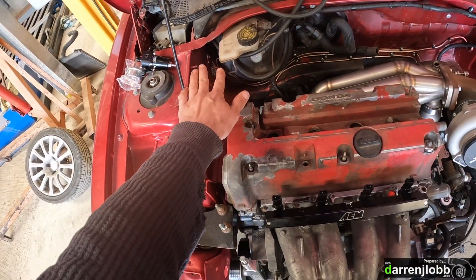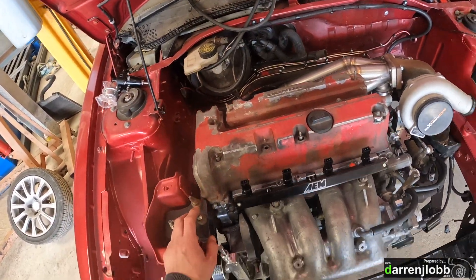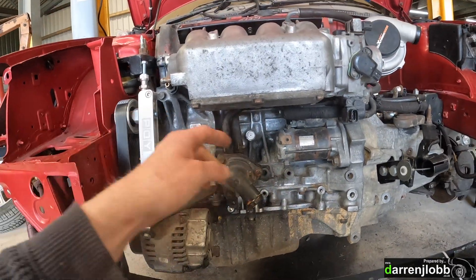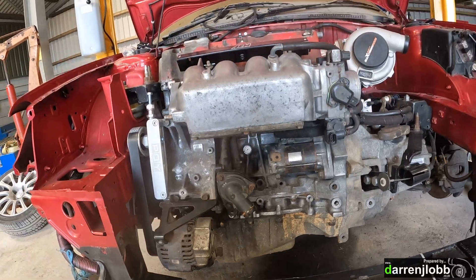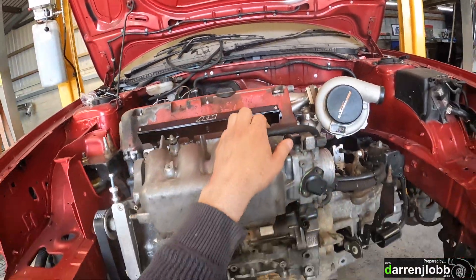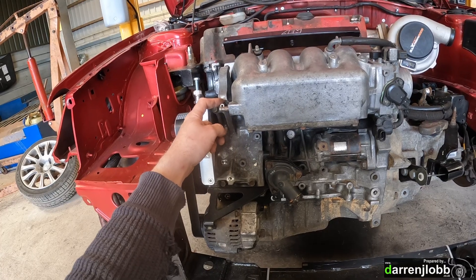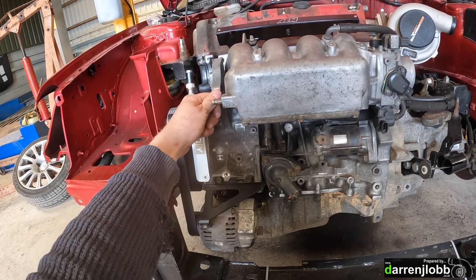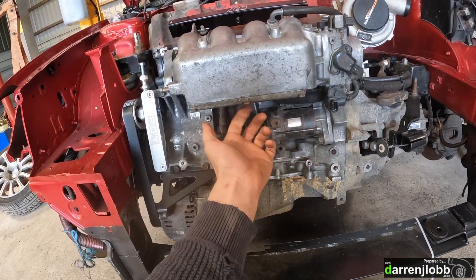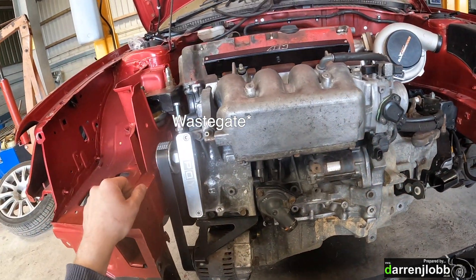I'll probably be mounting the fuel pressure regulator somewhere in that vicinity so the lines can come up nice and tidy, through the rail, and then return back to the tank. I'm thinking of adding some ports - there's a removable plate on the inlet manifold we could easily drill and tap a few holes in. At the minute we've only really got the large one on top which is for brake vacuum, already hooked up with a runner hose to the factory brake servo. The original port was for the PCV valve or crankcase breathing system, but we're not running that now because we'll be putting positive pressure in. We'll need a feed for the turbo actuator and also for the fuel pressure regulator so fuel pressure rises with boost.